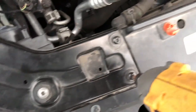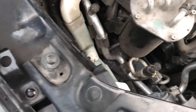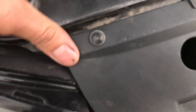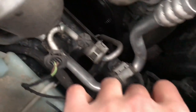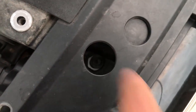Alright, look at that — that's a nice place to put a battery. So you actually have to take this screw out too. This is attached to it so we're going to go ahead and quickly do that. Alright, put all the screws up, now we're going to remove this plate and see what else we need to remove to get the headlight out. Just by looking at it we've got a plug here that we need to disconnect, and that's it for the headlight right there. Then we're going to remove that bolt right there.